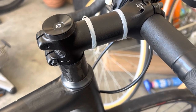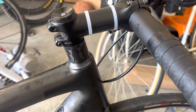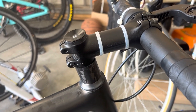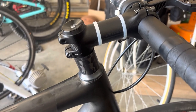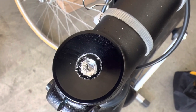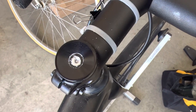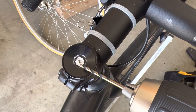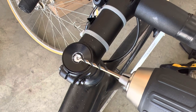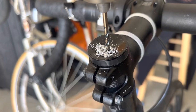I'm disappointed — I cannot ride this bike now. I'm waiting for the part to come in and there's a lot of work ahead. Will I buy this bike again? Probably not, even though it's a nice bike. Whoever designed this part probably has never done enough bike maintenance to understand these issues. My backup plan is to use a one-eighth-inch drill bit — that's 3.1 millimeters, slightly smaller than the four-millimeter — and drill all the way down to take out this long screw.